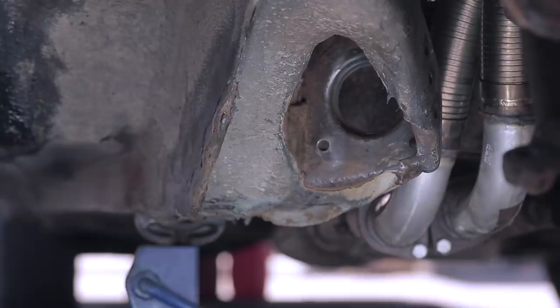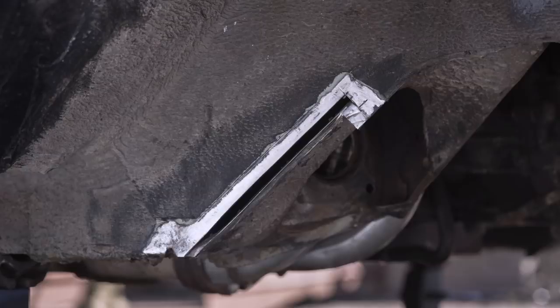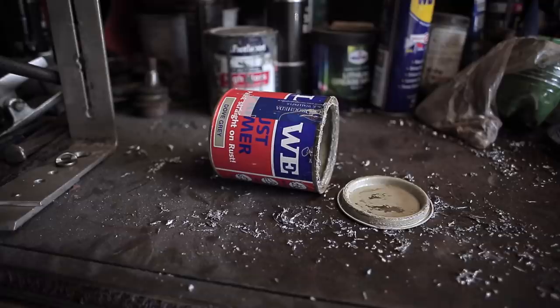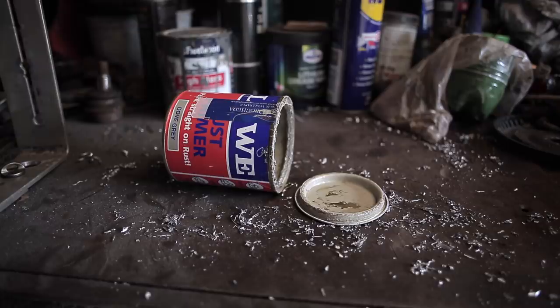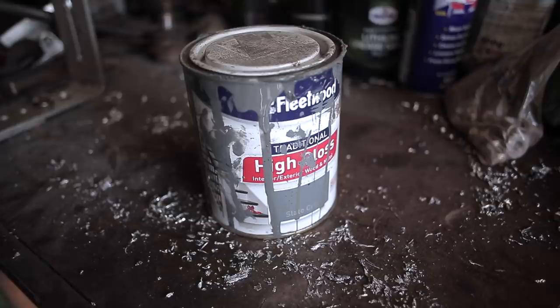Now, the single question I get asked more than any other is, what is the paint that I use when I'm prepping the places I've repaired? I gotta tell you, I am not a person to take paint advice for, and anyone who asks me is told that before I give the answer. The paint I use, it's a brush-on over-rust primer made by a crowd called Low. I have no affiliation, I don't have very much experience with it, but what I do know about it is, it goes on thick. It's one of these paints that's designed to go over rust, so I consider most of my stuff over prepared, and it dries exceptionally quickly.